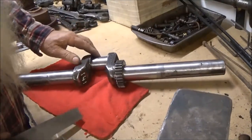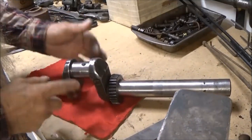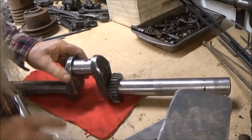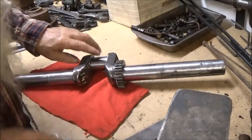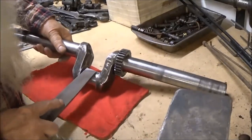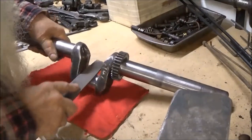If you put a micrometer on there, which I already did, it's pretty much round all the way around, so it's a good candidate. But it has this ridge on it right there, so I'm going to file that away. A big file is what you want to use — it looks like this.